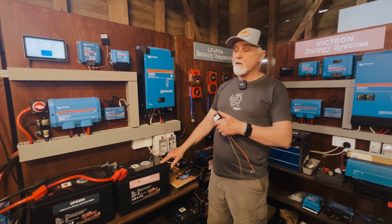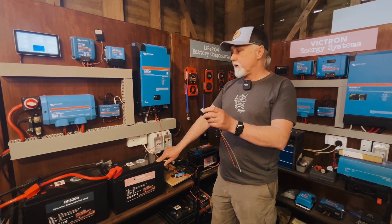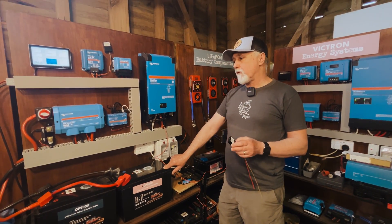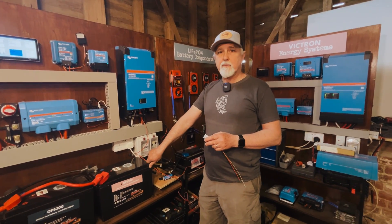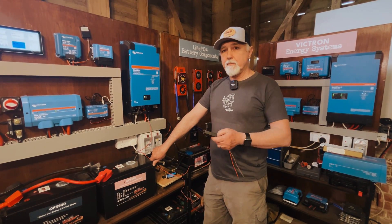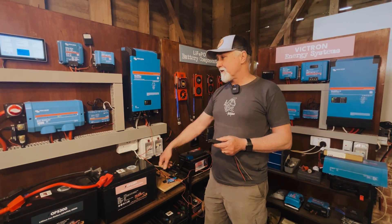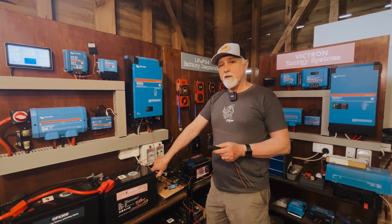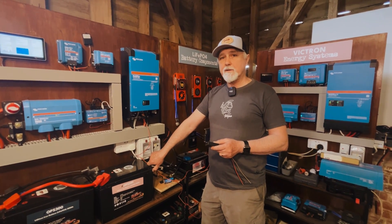Hopefully that's useful — you can use the MultiPlus trickle charge facility, or consider a Battery Master which is about £70 and works on 12 volts, so it wouldn't suit a 24V system. If you have a full 24V system and a MultiPlus, you can use the trickle charge since it outputs 24V — so that's quite handy. Leave any comments or questions below. Hopefully this has dispelled the myth that the trickle charge only works when the MultiPlus is turned on — it works all the time, day in day out, will always protect that starter battery, and you should always have a good voltage and be able to start your vehicle. Cheers, see you in the next episode.